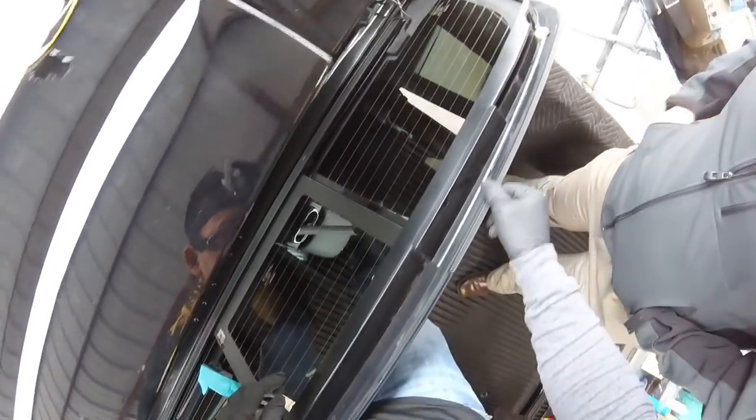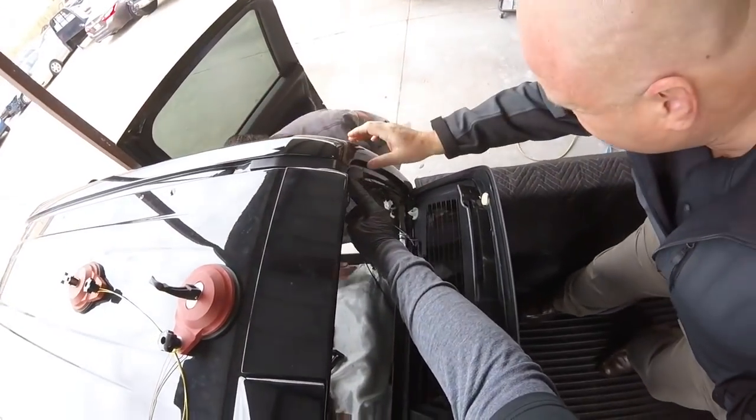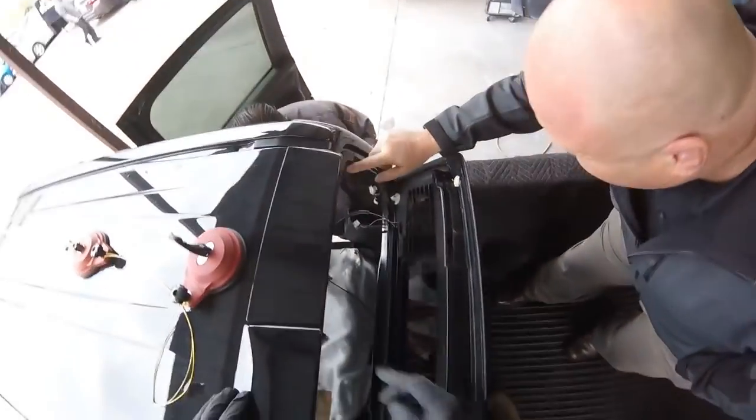Yeah, the other thing can be is encapsulates, they need to be primed. If something is missing with the primer, maybe that was the problem. You know, I need to unplug it. Because you see, all this is delamination. Yeah, we had this problem with Volvo before, but you see, we call it delamination on the primer. It's not bonded. That's right.